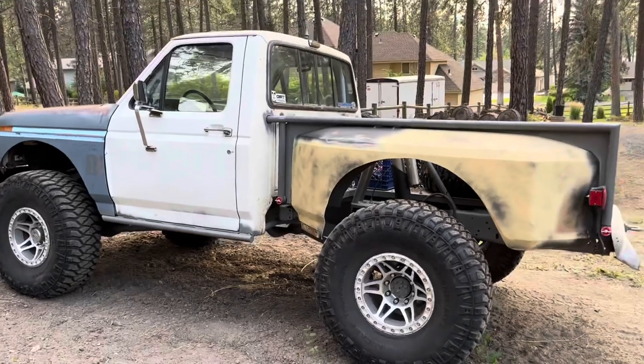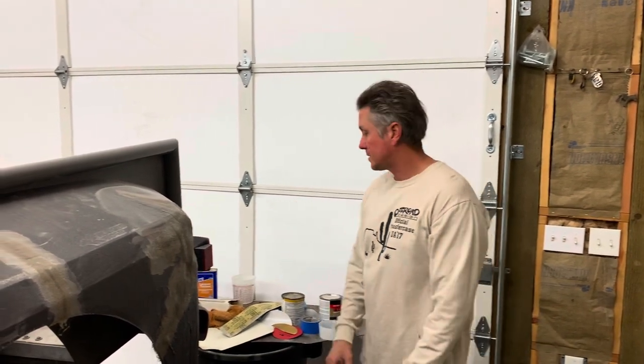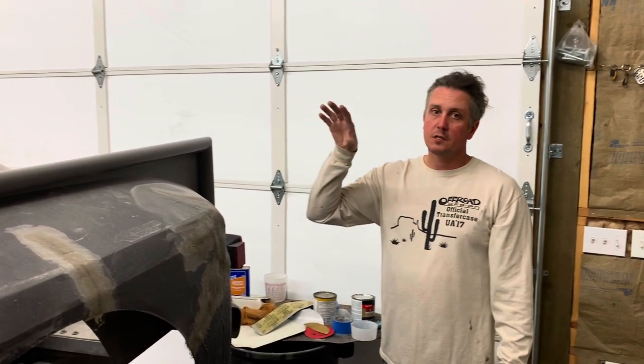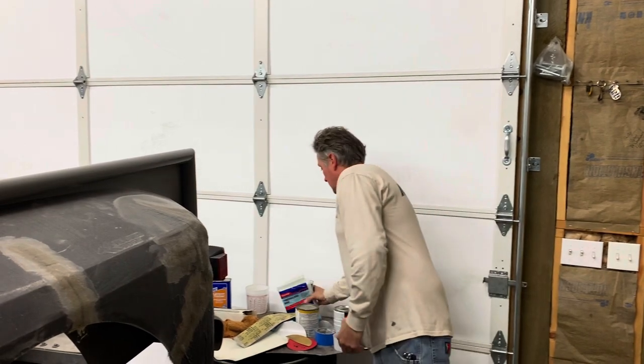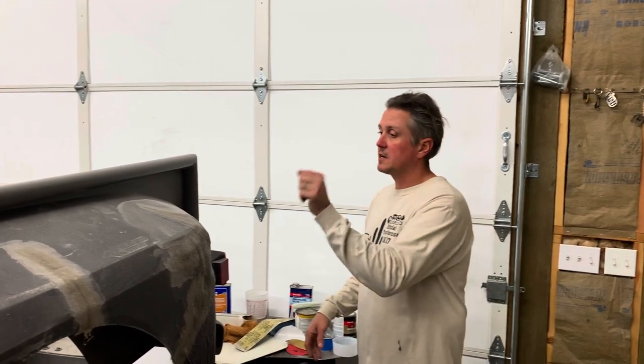Keep watching and I'll show you how I fix these fenders up. Before and while I was on the trail, these fenders I put on were all broken and chopped up — I actually punched a couple of big holes in these rear fenders. They're fiberglass and they took a beating, and now they're getting repaired. I failed to document the fiberglass repair process well, but all this is is fiberglass mat and fiberglass resin. Mix it up and use a two-inch chip brush — one of those cheap 99-cent paint brushes.